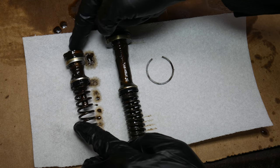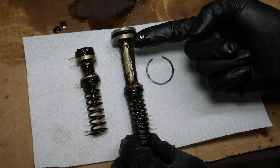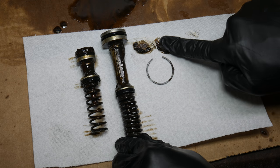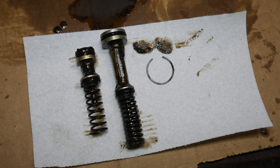We can fully appreciate how much gunk had collected inside of it. Some of the buildup is caused by brake fluid deteriorating, some of it is from rust inside of the lines, and some of it is from little bits of rubber coming off of the seals and the sides of the hoses on the braking system. But even if you don't know where it comes from, you probably know that you don't want all this buildup inside of there.